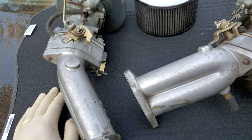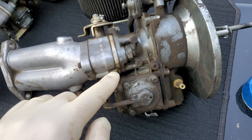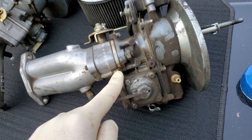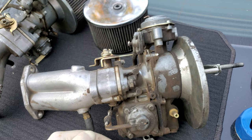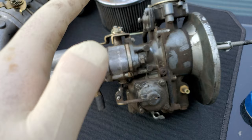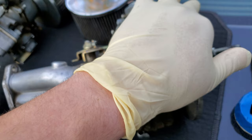You want to go off your engine RPM and make sure it's not idling too low or too high. Once you get your carbs both running the same throttle position so they're synced, you can go ahead and use your idle mixture screws. Once it's running, I will slowly — like very slowly — screw this in, sometimes even an eighth of a turn at a time. Let it sit for at least 10 seconds and see what it does. If it starts to stumble and run at a slower RPM, you know it's going too lean, so back it out slowly again until it runs smooth. Then you slowly turn it in, and once it starts to stumble, back it out another quarter to half turn so it's a little richer than when it was lean and stumbling. That's your idle mixture screw. Do that to both sides, then double-check that synchronization is the same.